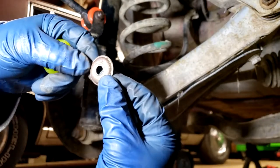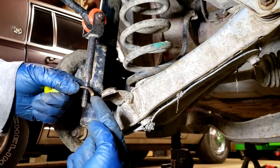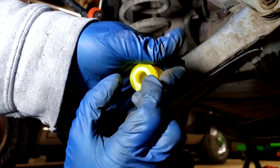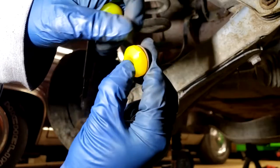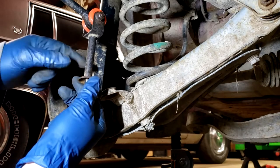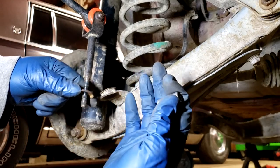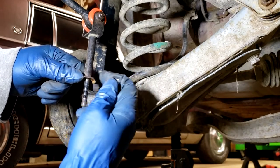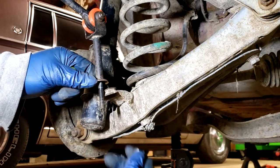If you're in a real pinch, you could just use a normal flat washer - just make sure it's one with a diameter that does not allow it to slide past that point. You wouldn't want it too small where it kind of digs into the bushing; you'd want it bigger than the bushing so it has a nice surface to ride against. You might also be able to find some cup washers that are the right size. I may also try to continue looking for other sources of these washers that would work, but a normal flat washer will do in a pinch - just make sure it slides over the bottom part but does not go past it.